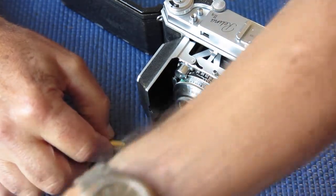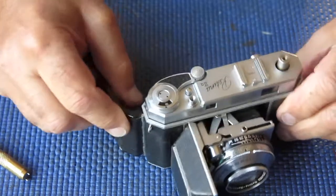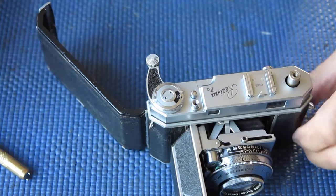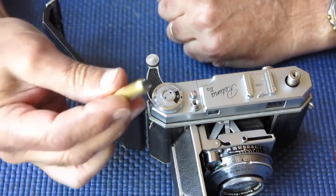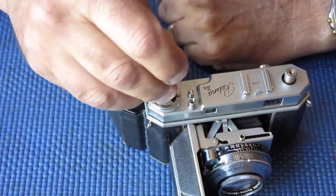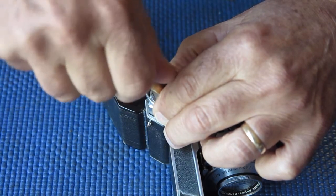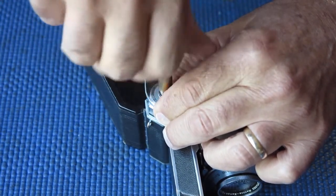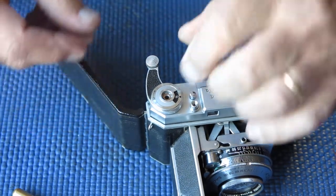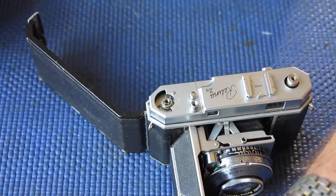You don't find those variants very often. So remove the rewind knob collar from the top of the rewind — don't lose it. For the film advance, swing it out 90 degrees. Do this now and you'll have a lot less grief later. Using a tool for the pin head screw, remove the screw. There should be a star washer in there — it might come out with the screw, so make sure you don't lose it. Lift off the film advance all in one piece; don't disassemble it.